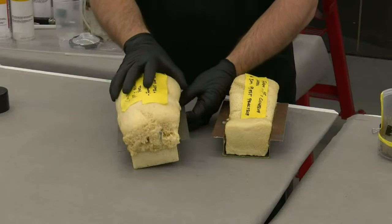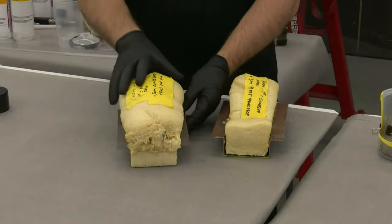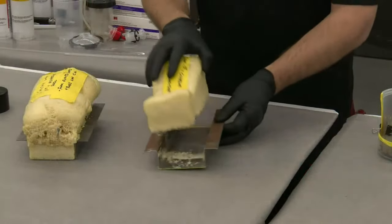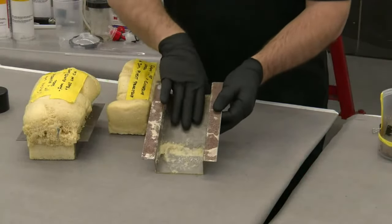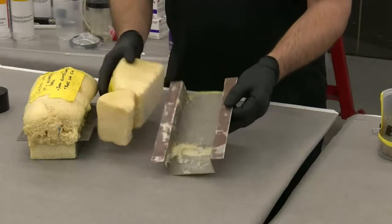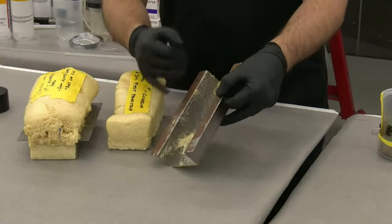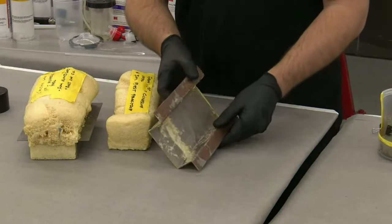And it doesn't matter if you have cavity wax in there, it's going to be scratching the heck out of it and exposing that metal substrate. Whereas if you put the foam in first, you can see how much cohesive failure we have inside this panel. It's all up on the edges here. And yes, there's rust on my example panel because there's no cavity wax.